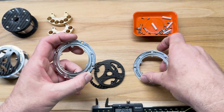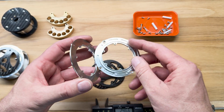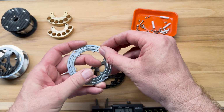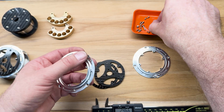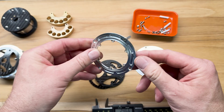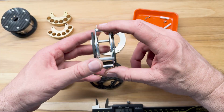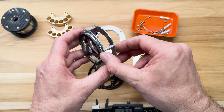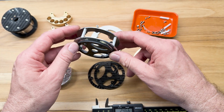So we've got an inside plate and an outside plate. These appear to be identical, which is great. And these bolts are flatheads. They're countersunk flush, which is nice, so you don't have the bump of a bolt head interfering with the tire. And they've only got 4 bolts going across. 1, 2, 3, 4. That doesn't seem like a lot of support in between. I wonder if they're anticipating the foam pushing down into this area, kind of like what I was thinking.